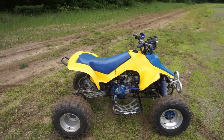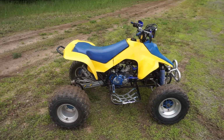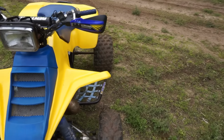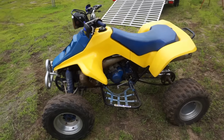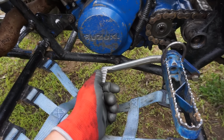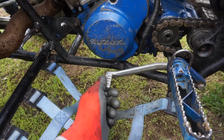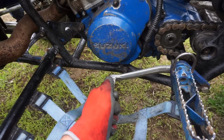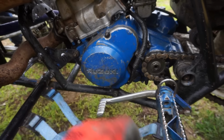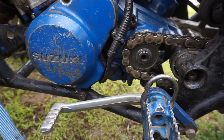Even though all the gears look perfect, drum looks perfect, shift forks look perfect. So I don't get it. I really don't get it. What the heck could be causing that? And I can feel the shifter move because I'm keeping pressure on it when I'm shifting into second. And I can feel it go back down into neutral. It'll shift back out of neutral and hit my foot. So something's not staying connected, or tight, I should say, which is really bizarre.